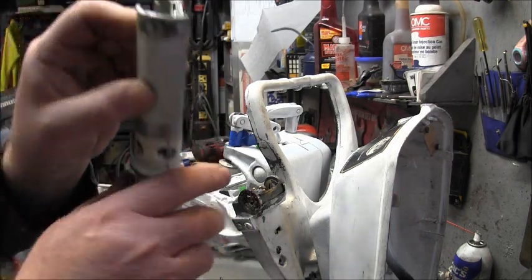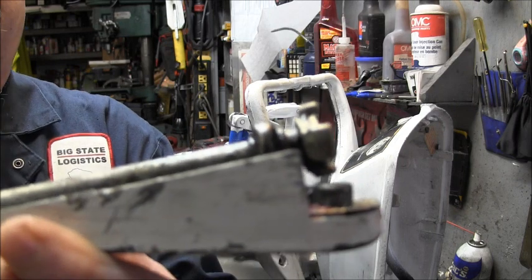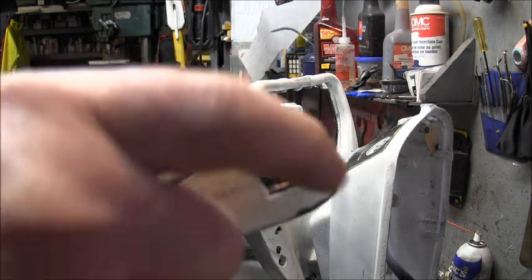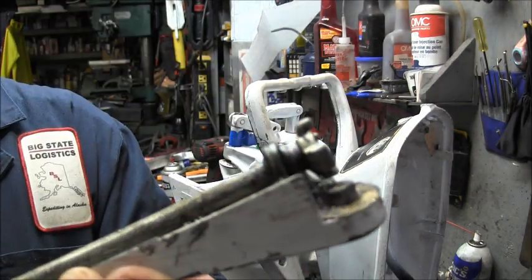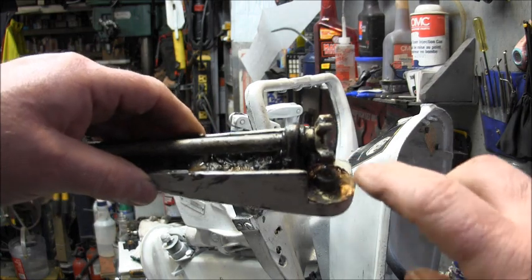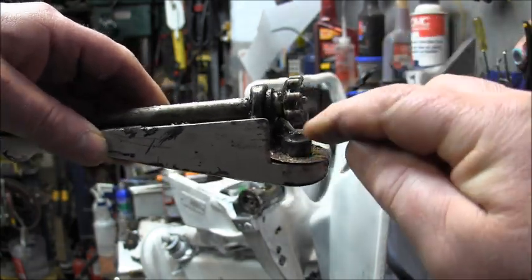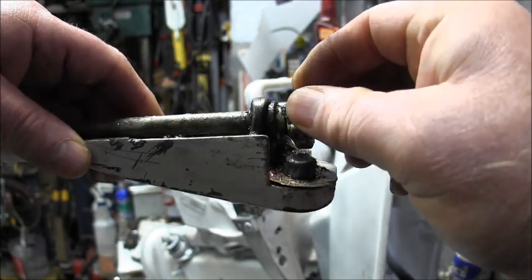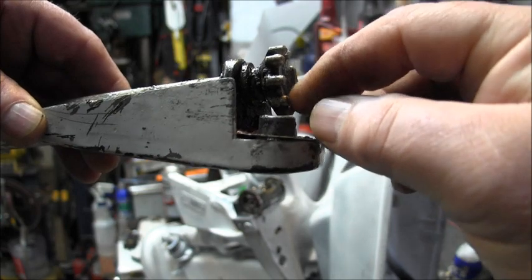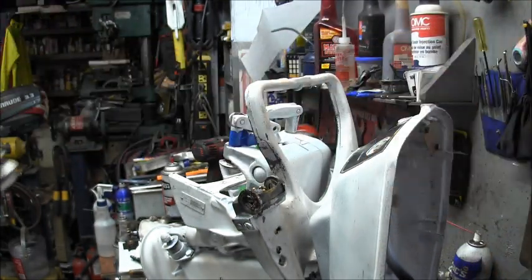Okay. And let me show you kind of if I can. Alright. If you look at this knuckle here, this brass knuckle, and you see the post here, and you can see I already put my shim. It's a little brass shim. Sometimes they're plastic, sometimes they're aluminum. But the distance between this post right here and these teeth, the greatest distance you're going to get is when you put this place where the big lug goes right there. You see the distance now? You can see this clearance here? Right there. If you got it like that, you got less clearance until the big lug comes around and that space. So you want to line that space up so you get that distance like that. Hopefully that made sense.